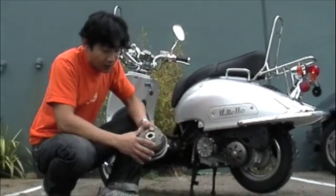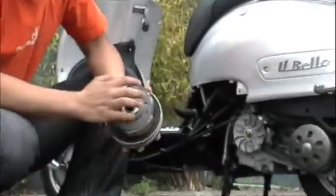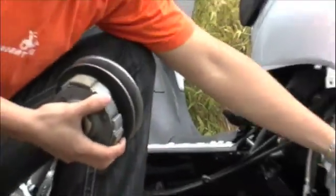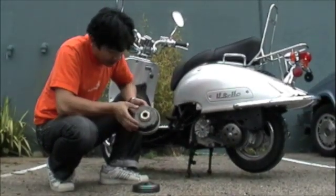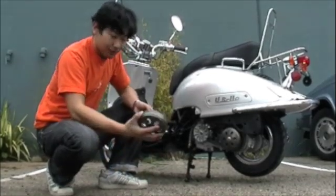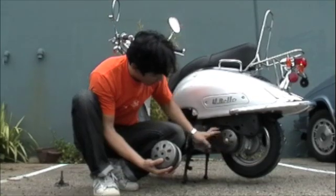Finally, you'll notice in the front of the clutch system you have these three prongs coming out. In a neutral position, the clutch is not engaged. However, as it spins faster, these three prongs open up and catch the outer shell of the clutch, grabbing onto it — and that's what turns the wheel.